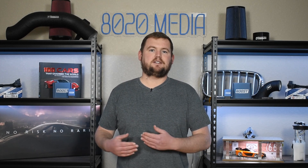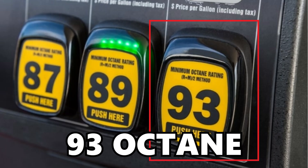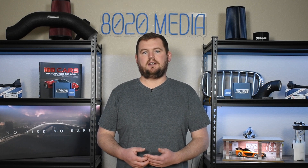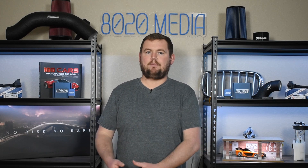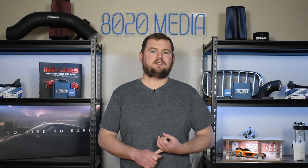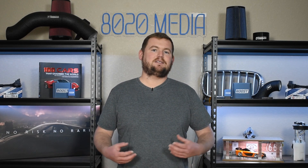You're really going to see the most impressive power gains on higher quality fuels — whether that be small ethanol blends or something like 93 octane as opposed to lower octane fuels. The same is true for custom tuning. These off-the-shelf tunes are great as a starting point, but once you have your EJ255 at a point you're happy with the mods, a custom tune is really going to be the best route for dialing things into your specific setup. It can help pick up that extra 10 to 15 horsepower while ensuring everything is safe and healthy.